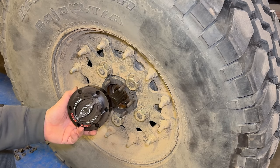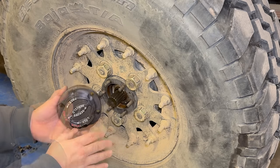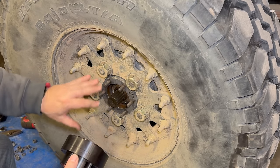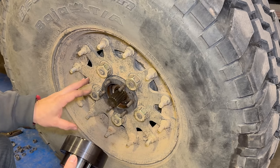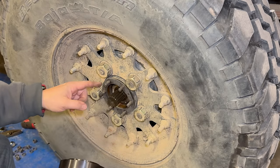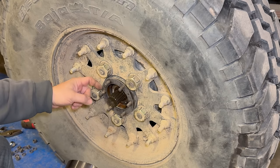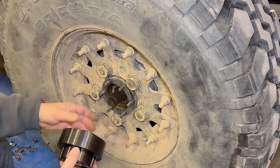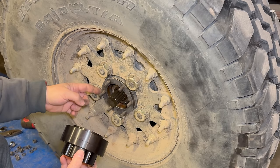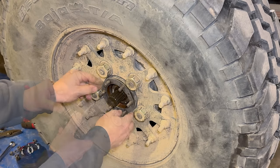This gives you a big advantage going off-road because with a locked differential you can control which wheels are actually getting power. And if you were to break something off-road — say I break this axle — I could just engage it to free and none of this is going to keep getting turned, so I'm less likely to do more damage. I'm going to have to take these studs out and replace them with longer bolts. The threads on the other side of the stud are bigger, so not only is this going to be very strong, but I'm replacing them with bolts that are much stronger than the original studs.